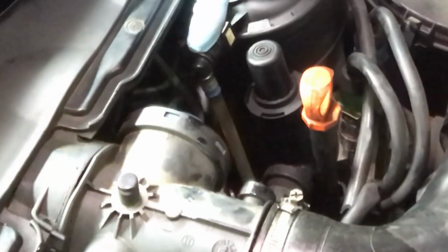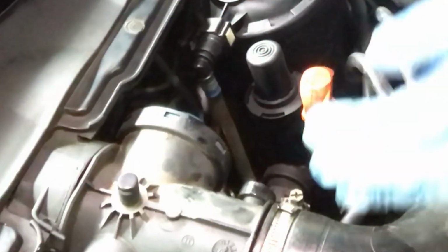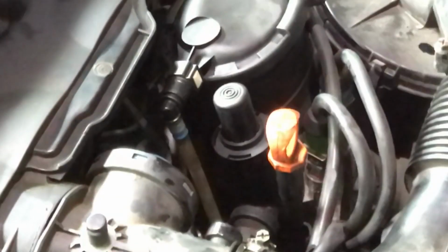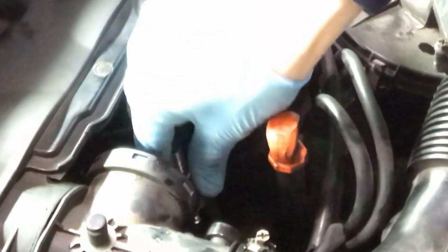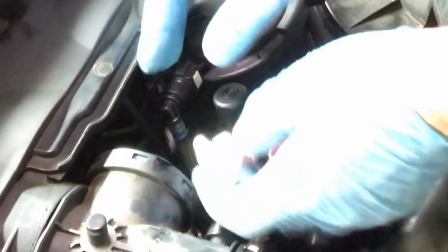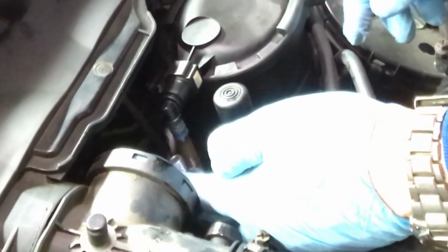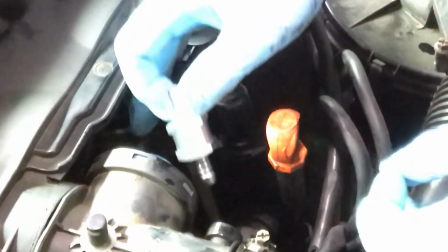This is the pipe from the filter down to the pump, so this is the one we need to pop it in. So I'm going to cut the pipe, we're going to pop it in there in line, and that should sort this problem out. Alright, so first things first, let's see how much we've got to take out of that. It's going to be a little bit fiddly to get it in there, but not the end of the world. I'm going to go right below that. It's going to go right off that connector there, and we're going to stick it in down to there. We've got plenty of room to do it. Putting the bottom Jubilee clip on might be a little bit tricky.